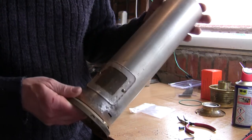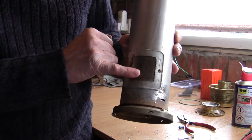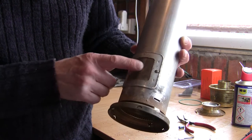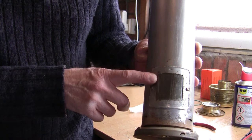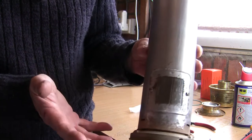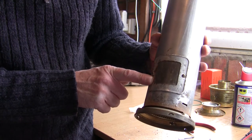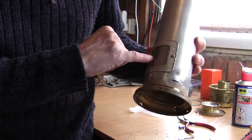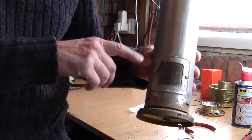While I'm also doing the refurb — just really getting it back up and running — I don't know whether you can see that, but this is a mica window, which is very crucial to these heaters because you look through it to set your flame height and see that your flame is running perfectly blue. This piece of mica — I think it would be the original; I bought this heater around about 2000 off eBay, new old stock in the original box, so it's well over 20 years old. I'm going to replace it. You can see those two brass screws threaded for bolts on the other side — you take that off and this plate comes off. I'll show you as I replace the piece of mica.